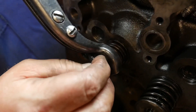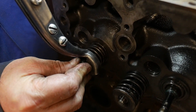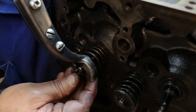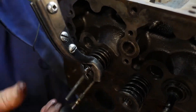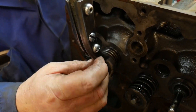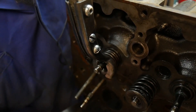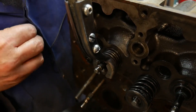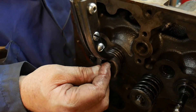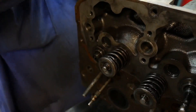Now for our keepers, or collets as we call them, I'm just going to keep my fingers there as I release this. The spring will push my fingers out of the way as the collets or keepers go into place — and that one didn't go, so I need to compress that again. There are special tools to hold these in place, but I never bother with them myself. And that one's in place, and gravity will hold it there. Now if I can put this one in place without disturbing it, get them in place like that, and I can release that, and it is in place.